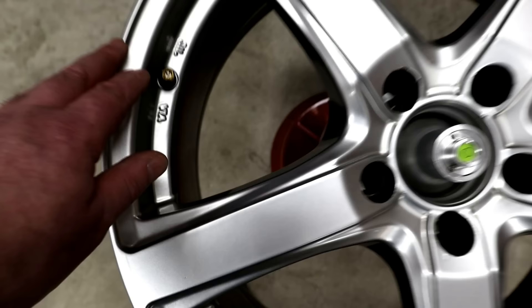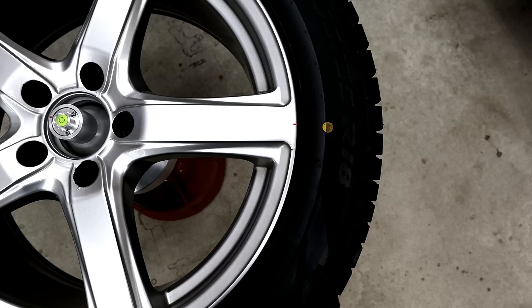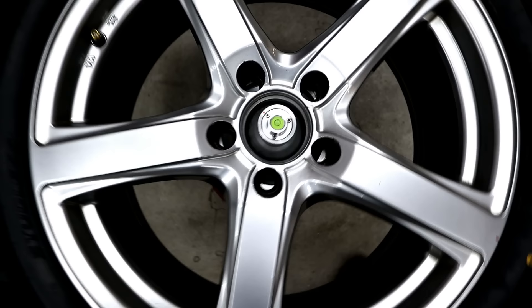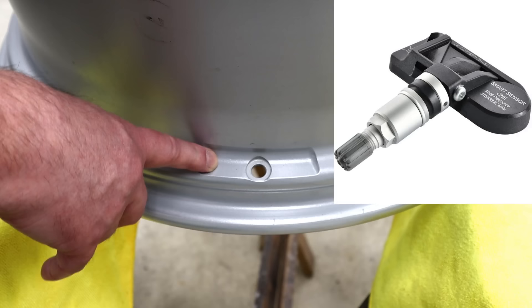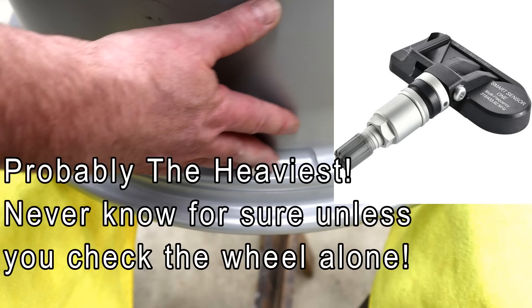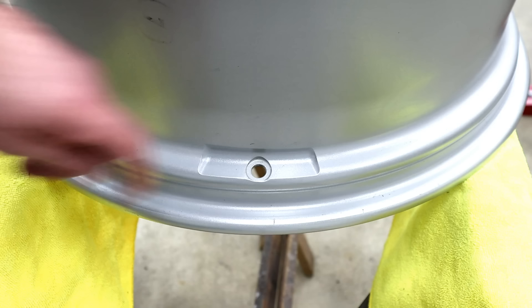I'm having to press down slightly to center the bubble, and match balancing this tire with the yellow dot on the opposite side — which is the heaviest part of the wheel and lightest part of the tire — we've got a perfect balance without any weights needed. Obviously if you've got TPMS sensor valve stems, this will be the heaviest part of the wheel, but if you're just using regular valve stems, this part of the wheel is actually probably going to be the lightest.